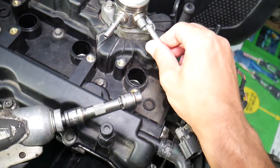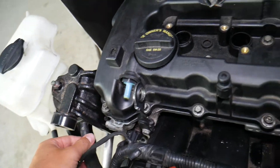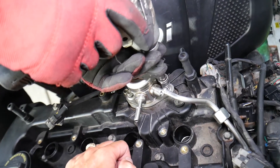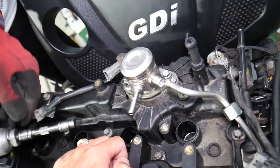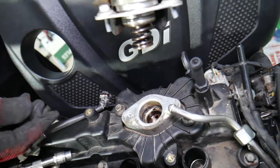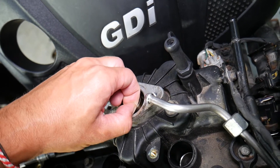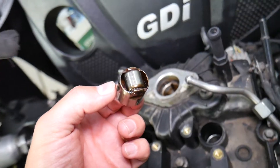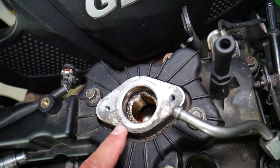That line can come out like that. Next, remove the PCV hose and get it out of the way. Now, two bolts for the high pressure fuel pump — remove them a little bit at a time, one then the other, not one all the way, because it's a spring-loaded pump and depending on where it stopped on the camshaft you can have quite a bit of tension. This is also the time to inspect your tappet, because if it fails it can destroy your engine. We'll have a link in the description where you can buy a replacement.